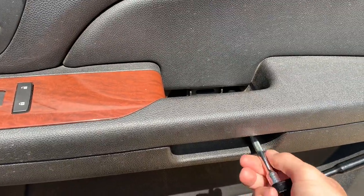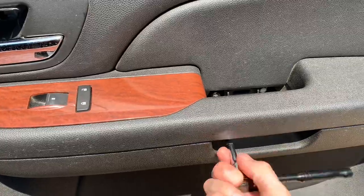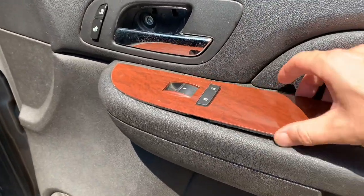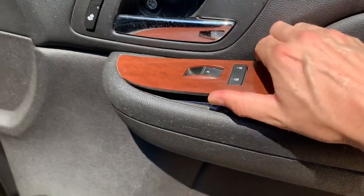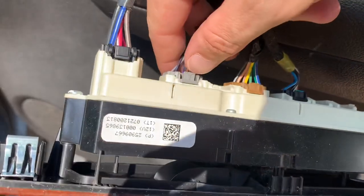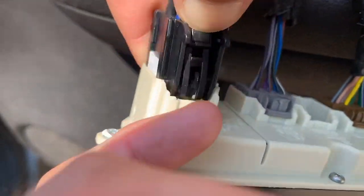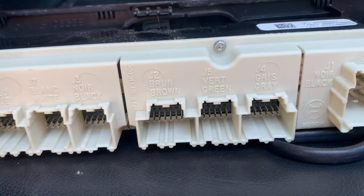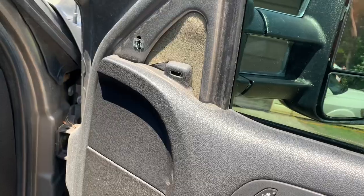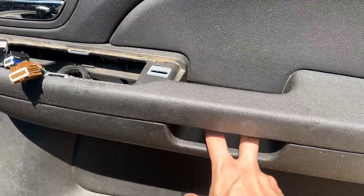If you have an Avalanche or an Escalade or something, it's probably the vertical armrest style. Next thing you want to do is pop out your switches — whether it's driver's side or passenger side, they just pop out. This one has four plugs. You push this button here and then you can pull it out. There's a locking tab here. You don't really have to worry too much because they're labeled, which is pretty cool. Got the triangle off, got the bolt out, got these two bolts out, and wires are undone.